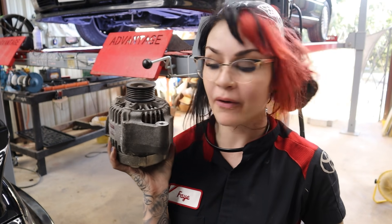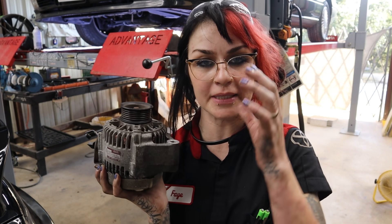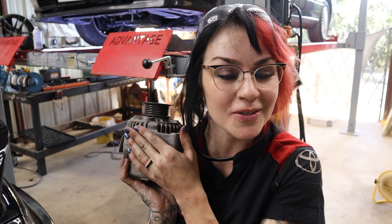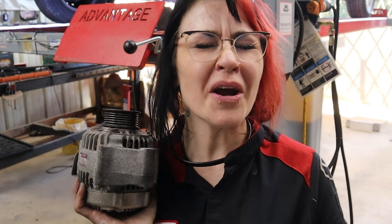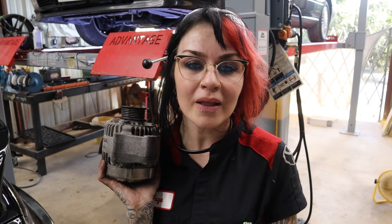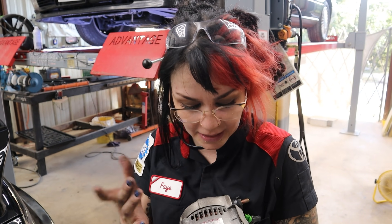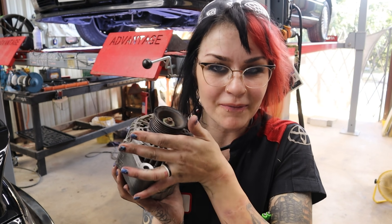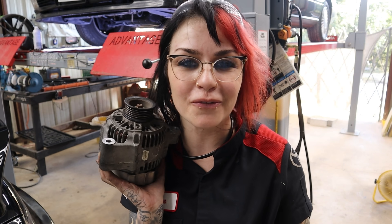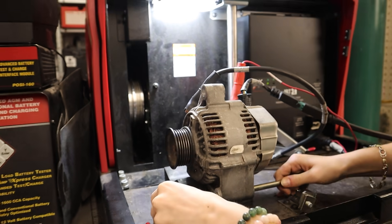It is very, very warm. So what if you've got it out and you're inspecting it but you still don't really feel good about your diagnosis? Well, we can actually take this to an auto parts store and have them test the output for us — one last step before we buy a new one. This is a Japanese model, so I just wanted to make sure I was able to see the part number and order the correct one. Also, I believe this is the same for the 2JZ, so I already have quite a few of these in stock. We're going to take this to O'Reilly's together and just get this tested.